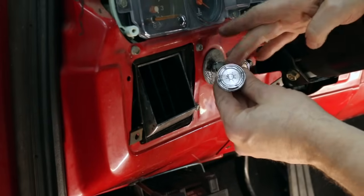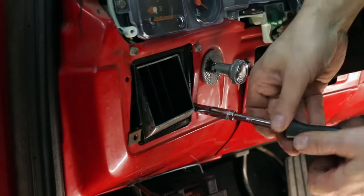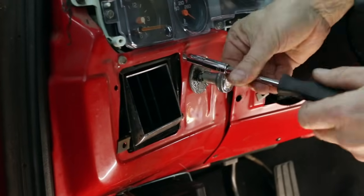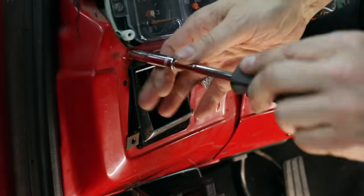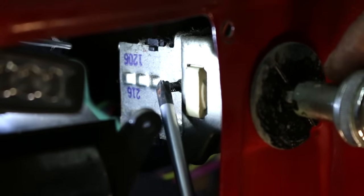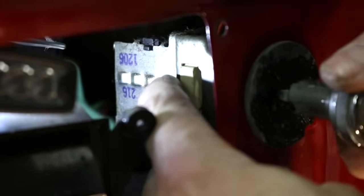We're going to replace our headlight pull switch. If you've ever been frustrated by this or ever wondered how, I'm going to show you. First, you got to get access to the switch itself. And in this truck, it's easy by removing this vent. Now, this little tab right here, this button is a release tab for the shaft of the switch. You've got to reach in there and fidget and press it.